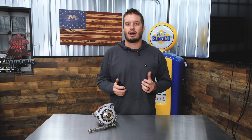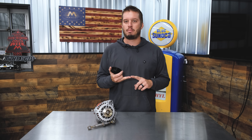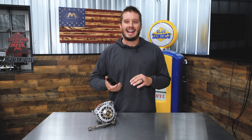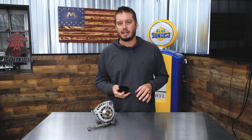So what's the first thing us hot rodders do? Take the rev limiter off, spin it to 8,000 and send it. And that's really what causes most of your failures in alternators. Over the years, I personally have blamed them on being old, blamed them on being off-brand from the parts store — just anything. Come to find out it's typically because we're overspinning these alternators.